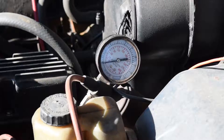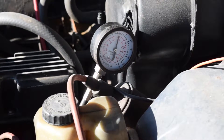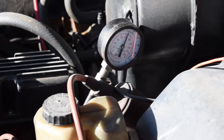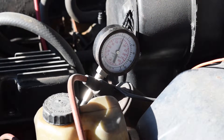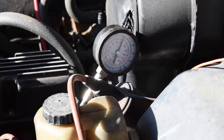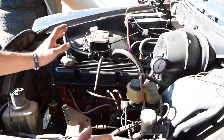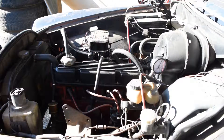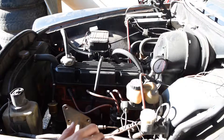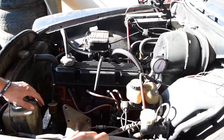We'll check cylinder number four and see what that reads. This is cylinder number four compression. That is dead on 150. So, 150 I wouldn't consider low compression for this engine — I've seen some 60 psi, so that's low compression; 150 is not that bad. We got 145 in number one, 120 in number two, 120 in number three, and 150 in number four. That is also another sign that could be head gasket, maybe separation in the two middle cylinders, or the head's warped or something.